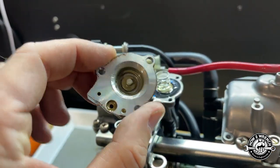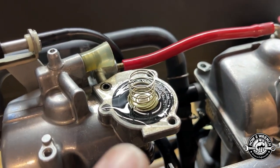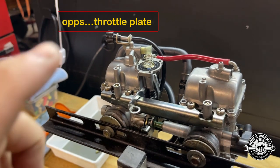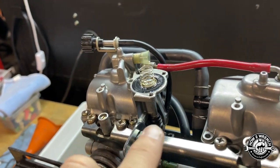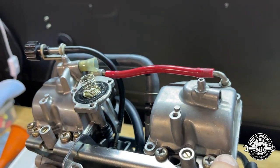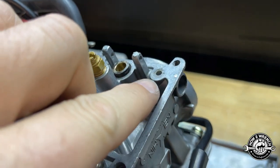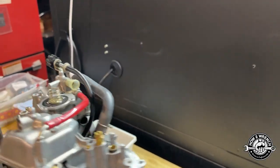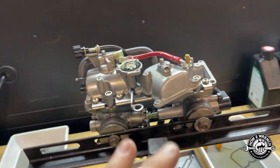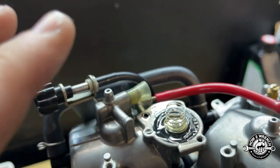I took the cap off for the accelerator pump and you can see it's wet — that's another good reason to wet-test. It means fuel was getting in there. This test wasn't actually operating the throttle body to see if the accelerator pump circuits were working. This crossover tube is what's supplying fuel to this carb — it goes out this nozzle, through this nozzle, and out that nozzle there to inject into the carburetor. I don't worry too much about that until assembly — I know I'll clear all those passageways, prove there's no tears in the diaphragm, and make sure the O-ring's in place.